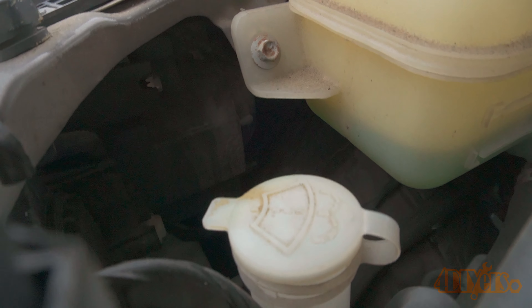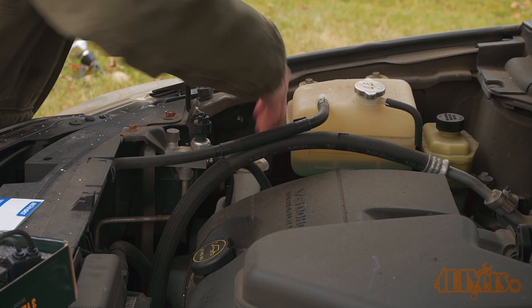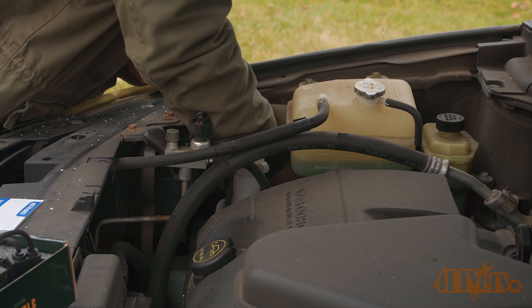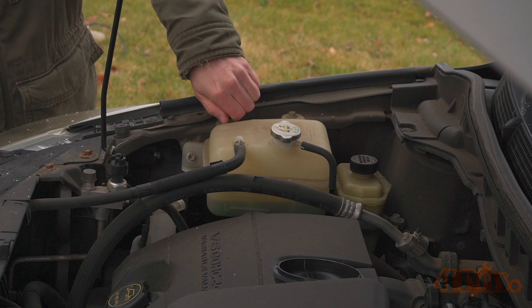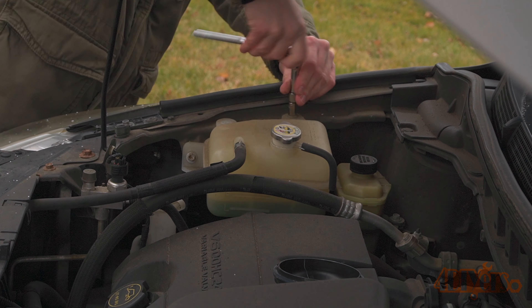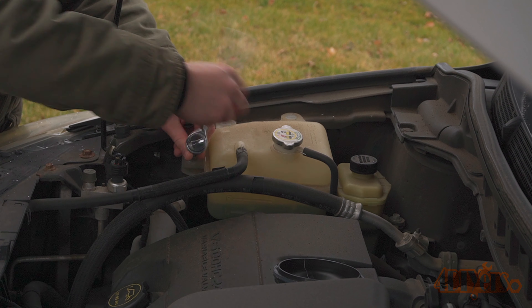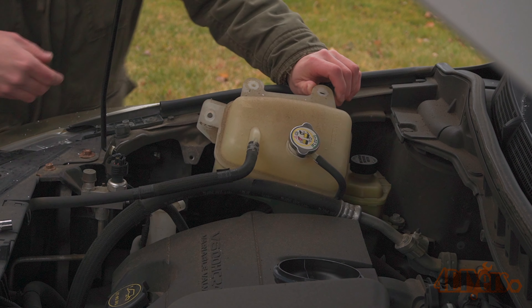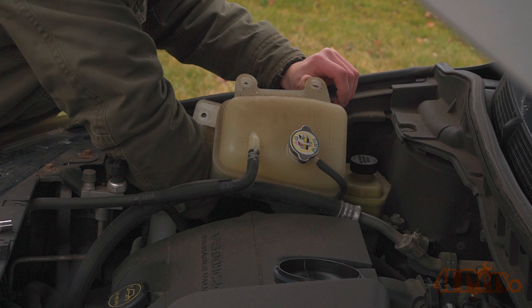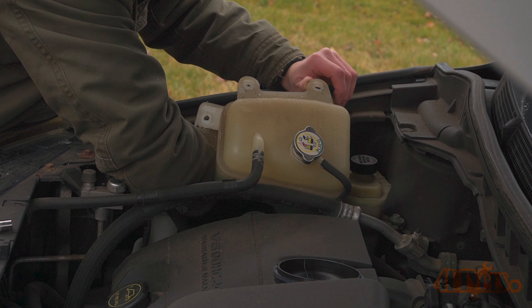The replacement is fairly straightforward and minimal tools are needed. Starting with the passenger side first, remove the dome cover by rotating it counterclockwise. Using a 3/8 drive ratchet with a 3 inch extension and a 10mm socket, remove the three bolts on the coolant reservoir. Once those bolts have been removed, you can push the reservoir back towards the windshield. Do not disconnect the lines. Then in order to access the bulb, unclip the connector and rotate the bulb counterclockwise, then pull straight out.